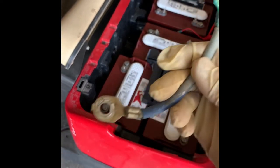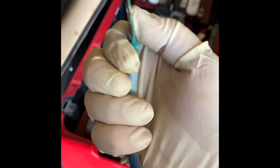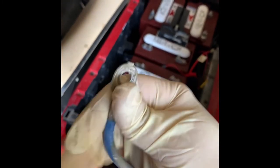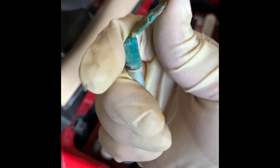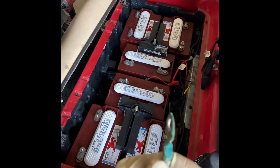Let me find one that bends to show you what it looks like. This one came off another battery job — as you can see, this side is probably fine but this side is heavily corroded. Put your hand right there and push with your thumb — if it bends, it's no good. The uncorroded side: no corrosion, still good. Try to push it — the whole cable is trying to move with it, so that side's good. But this corroded side bends pretty easily, so throw that cable away. Chances are it's going to melt the terminal or corrode off and kill the golf cart while you're driving around.